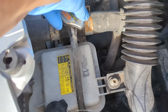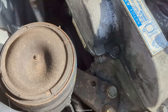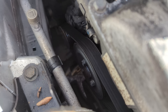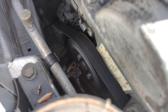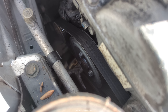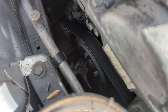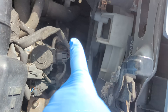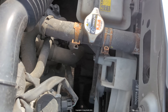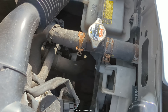If we open the radiator cap, there is fluid in there but the level is a little bit low. If you identify a low level like this, you might then need to start looking for leaks. In this car's case, a mechanic who did the road inspection said he could see a little bit of coolant weeping out of the water pump, so that's something that's probably going to need replacing soon — it's not a very bad leak yet but that's the likely cause. If it's not the water pump, then you need to look at the thermostat, all the hoses, and the radiator itself. Coolant is commonly colored quite brightly — red, orange, pink, or bright green — so coolant leaks can be fairly easy to see.